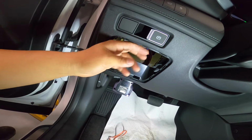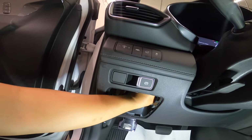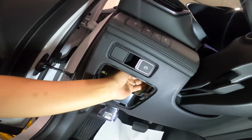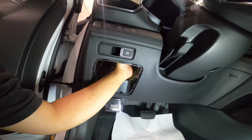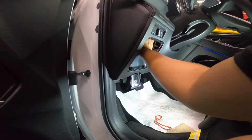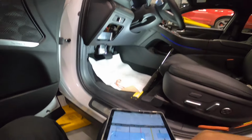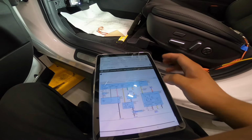What? Why is there a rubber band there? Can I see it? That's the question. Can I feel that wire? Because it says there should be a ground there. I don't see it there. Well, I'm just feeling it here. Because GM01 is there, and that's also the ground on our blower motor. Let's go first.